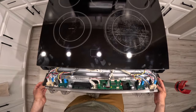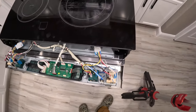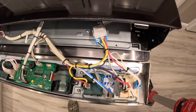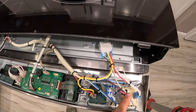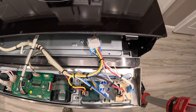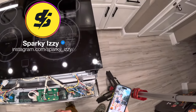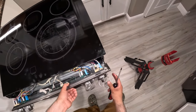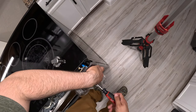I'm having an issue with this heating element, which corresponds to the far right switch. As you can see, that connection is burnt up — I can no longer use it, so I'll need to crimp on a new female connector. I already checked and the wire is rated for 600 volts, which is why I made sure to get crimps rated for 600 volts as well. Go ahead and take a picture of the wiring so you know how to replace it. The knob slides out and there are two screws in front to remove the switch.